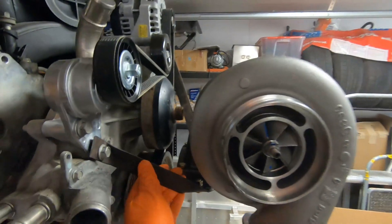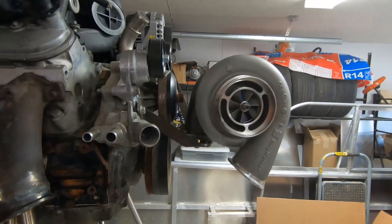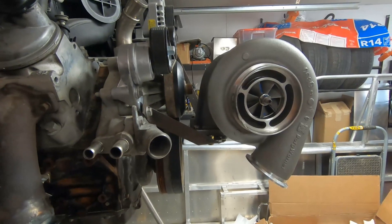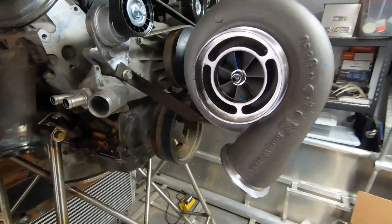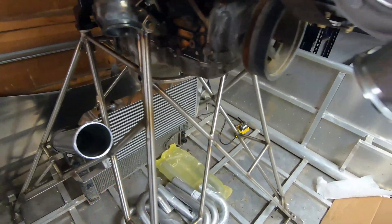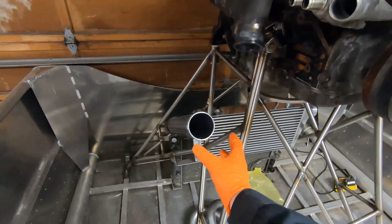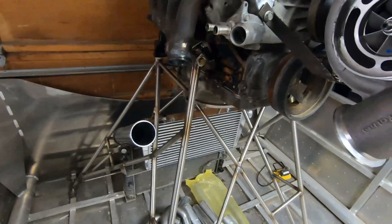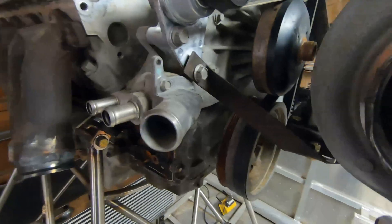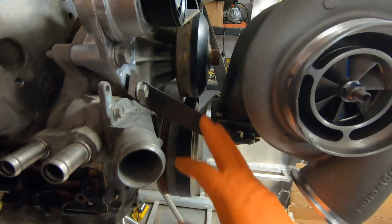In the last video I made this bracket and flange to mount the turbo on the front of the engine. Overall it's not too bad — I was a bit concerned about the space between the turbo and the front of the engine, but I think it's okay. It's probably ideal to be a little farther away, but I could make this work. One thing I'm looking at now is continuing the mock-up, and I'm thinking it might be easier to just shift the turbo over a little bit rather than fabricating an S-tube to line things up.